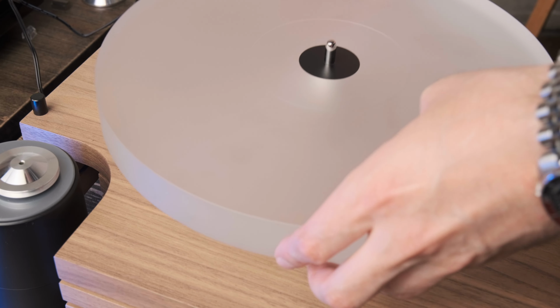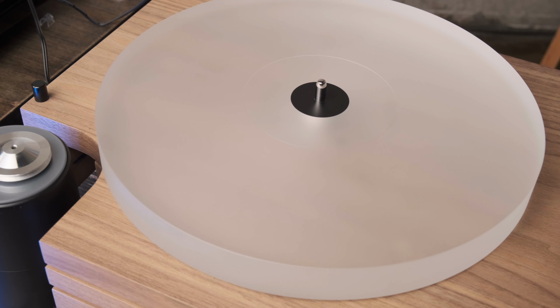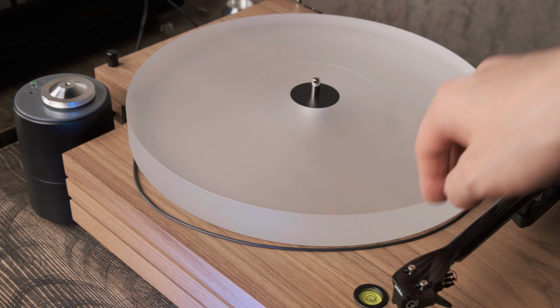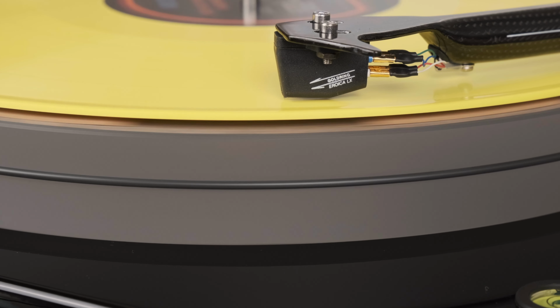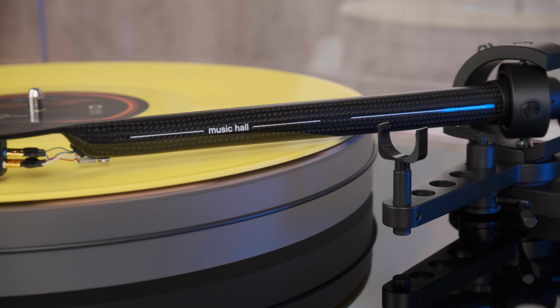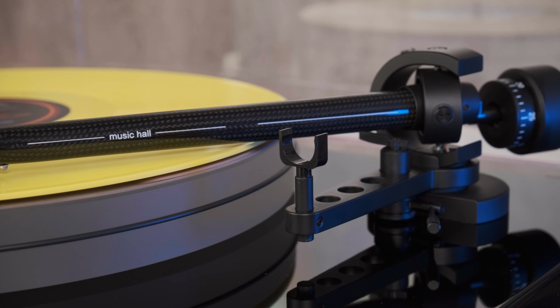Here it is made of a thick acrylic chunk, another great material for a turntable, because it almost doesn't transmit vibrations that can come from the main bearing, because the metal and ceramics from which the bearing and spindle are made are capable of transmitting them. Thus, the acrylic disc is a guarantee that this part of the structure won't spoil the sound. The upper plinth carries the tone arm, and as you can see, these turntables have 9-inch tone arms, very similar to the ones Pro-Ject makes.